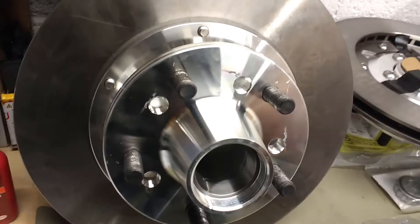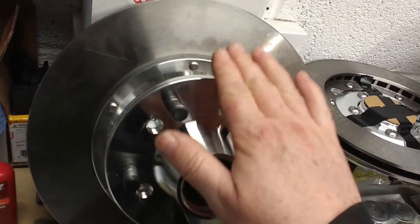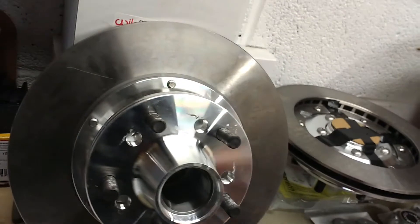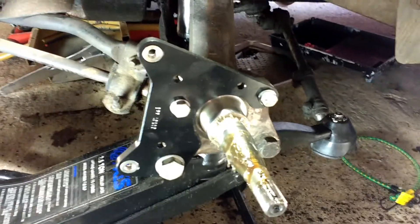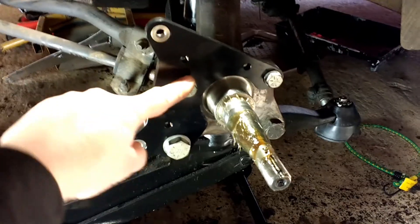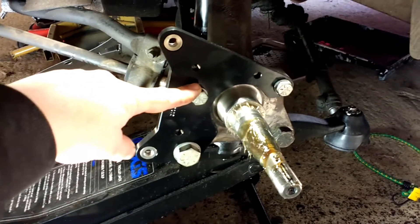Here's another small but important detail. When you bolt your wheel on, it doesn't contact the mounting face uniformly — it contacts at certain points, which you can see. This is why they say that if the contact points of your wheel overhang the aluminium disc, you have to use the steel spacer ring. This is filmed on the left, driver's side — so you have the plate towards the front. These are supplied in the kit; you put thread lock on them and do them up to 47 foot-pounds.